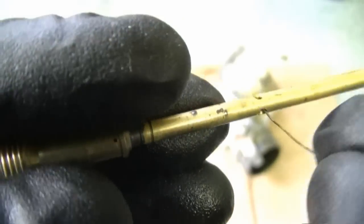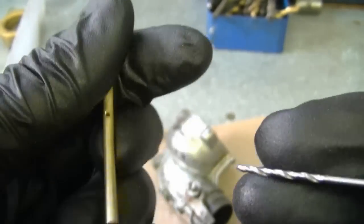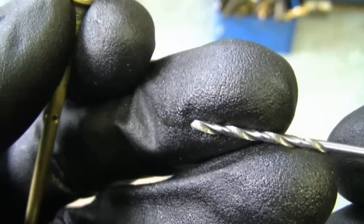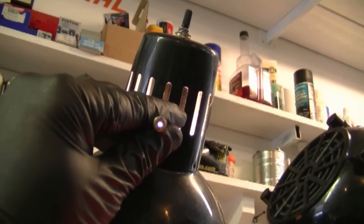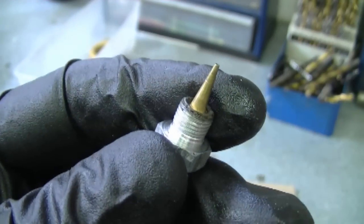Right up here there's a tiny hole — you want to make sure it's unplugged. Run the wire through the holes on the tube. You can see through it so you know it's clean, and just repeat the process all around this tube. I've also got a 1/16th drill bit that I'm going to run inside the tube — if there's any dirt it's going to stick to the bit. Do the same over here. It looks pretty clean because I don't see too much dirt on the drill bit. Often I'll blow on it to make sure it's unplugged; if you can hear the air coming out, that's good. You can also blow on one end, hold the other end, and the air should come out of the holes in the center of the tube. If you look at it in the light you should see that the center hole is totally unplugged — that's what you want; you have to be able to see right through. Now to clean the end of this I'm just going to run it quickly on my wire brush.